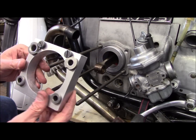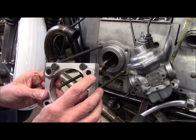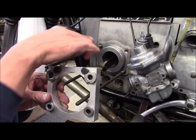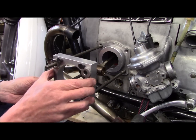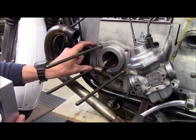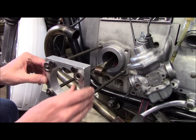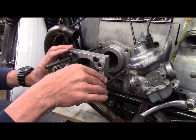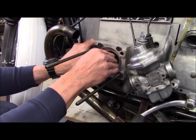The next piece of the jig is the drilling portion. There are two bushings — this one is for the drill bit and this one is for the tap. I put the drill bit bushing on the side where I want to drill the hole. This is just used to help guide the jig onto the cylinder studs. One thing to remember is that these studs are drilled so the distances here versus here are different, so if you rotate the jig it won't fit. You have to put the jig in the right orientation to match up with the distances between the cylinder stud holes, then slide it home over the plug in the cylinder bore until it's up tight against the engine case.